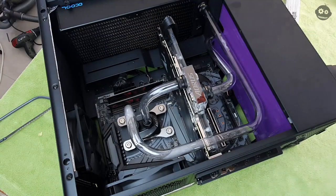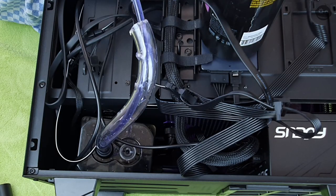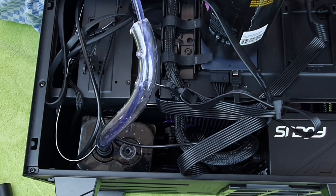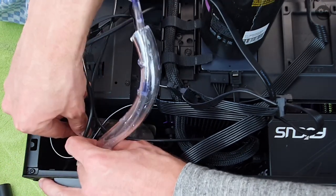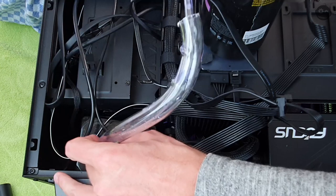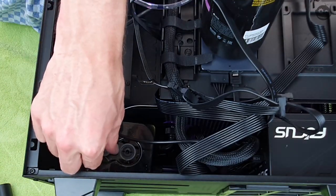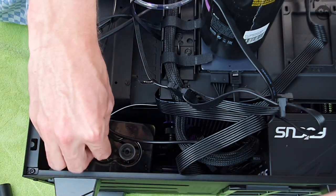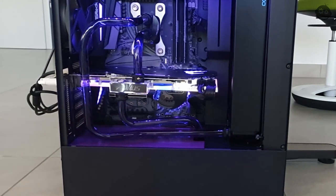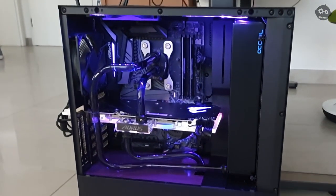We used some soft tubing to connect to the radiator, because it's such a tight space down there that I didn't want hard tubing going to the pump — I can't move it anymore. The last tubing to go in was quite a complicated part, so I was happy after bending it. I used some heat afterwards to get the stress out — it's quite springy, so don't overdo it, just slightly heat up the pipes to release the tension. Then I filled the whole thing with water and of course I messed up completely and there was water everywhere over my case, but in the end I got it done. I had to run the system for a while to get all the air bubbles out; this pump — the DC-LT 2600 — is not very powerful, but it worked after a while.